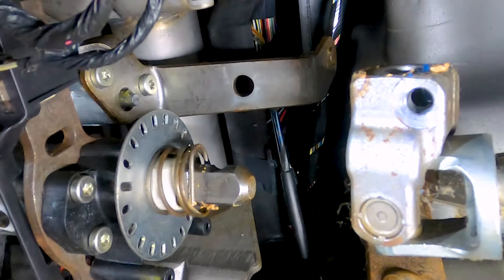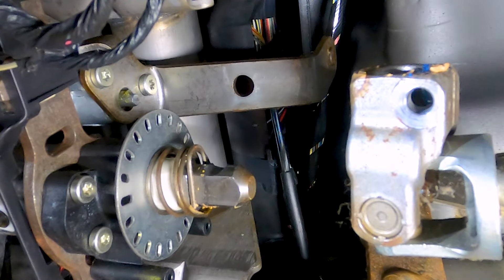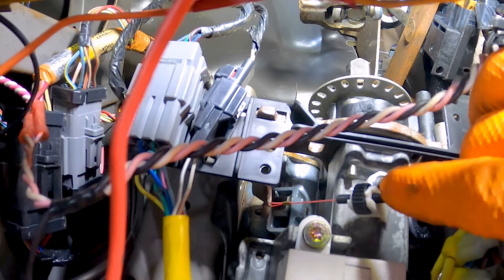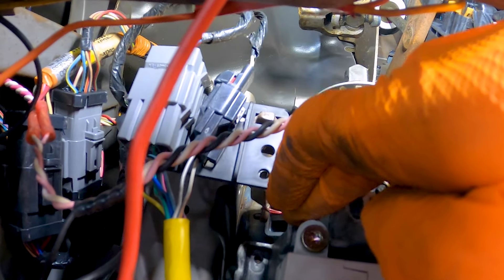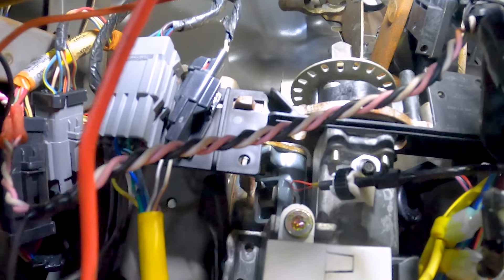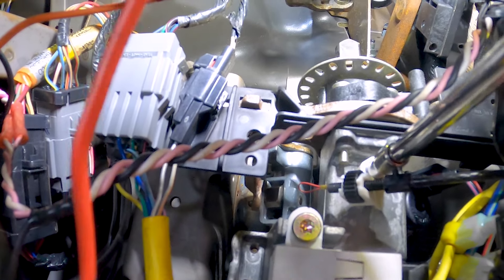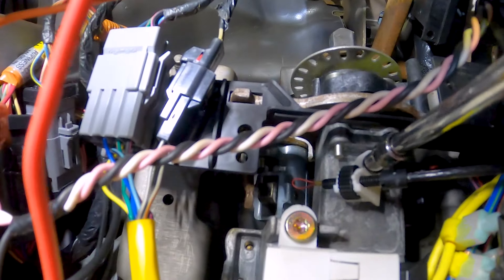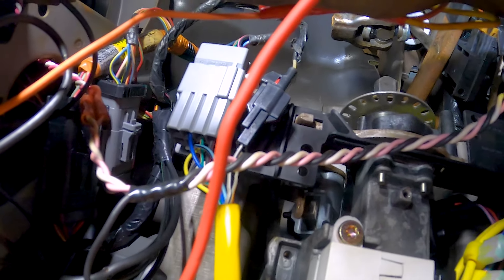See how it automatically wants to spin? The tape, thank goodness, is stopping it because you do not want that to spin. This is the cable that's the indicator for your shifter — it's spring-loaded. I'm just going to bring it right up here and undo it on the hook. I think it's a 5.5 millimeter socket — this little socket right here.